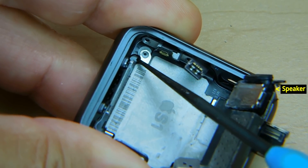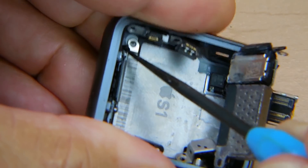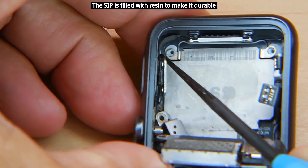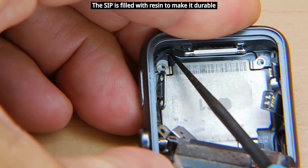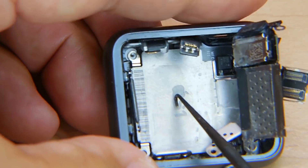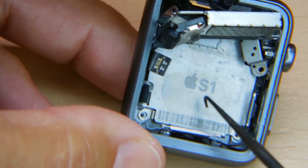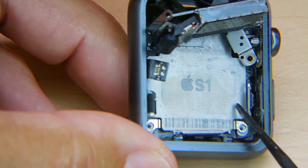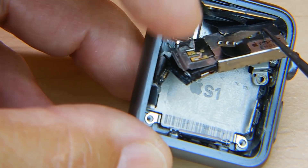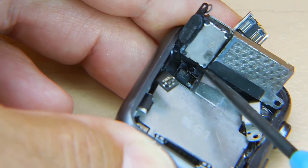In this area, pull — see if it comes out. Yeah, it's glued. I just heard it separate, so that side's off. Now let's go over here — the other side's probably glued in too. There we go, so that all pulled out. You definitely would never be changing any of these other parts. The only serviceable things inside here for the average person would be just the battery, the gasket, and the front panel. The taptic engine is not exactly easy to replace.